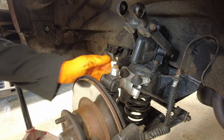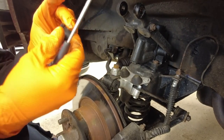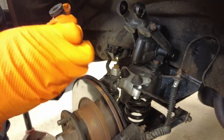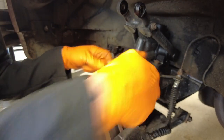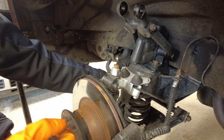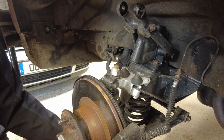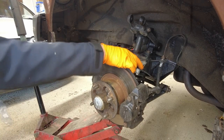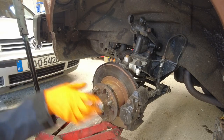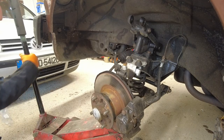Let's get them out - they're in two parts so they should come out fairly handy. I'll keep these bushes as they're in reasonable order. Now we can put our new bushes in there, but we're not putting this back on yet. With the spring tension off we have to undo the nuts in here, which is a bit more of a faff. We're going to drop the jack down off the suspension now - this will allow the spring to come out.